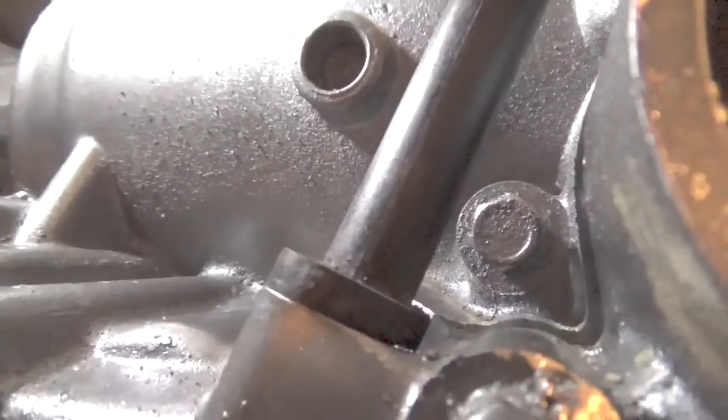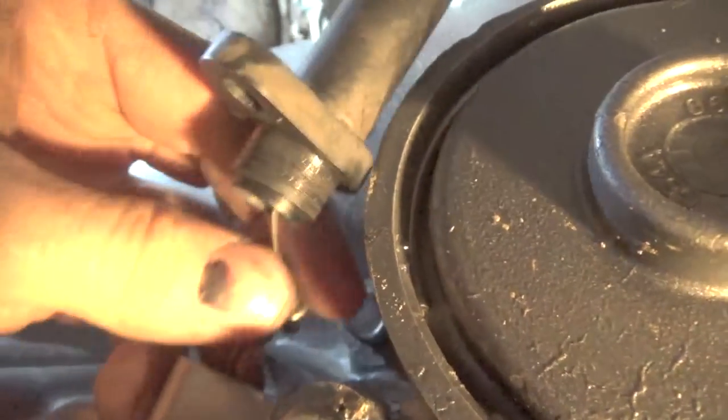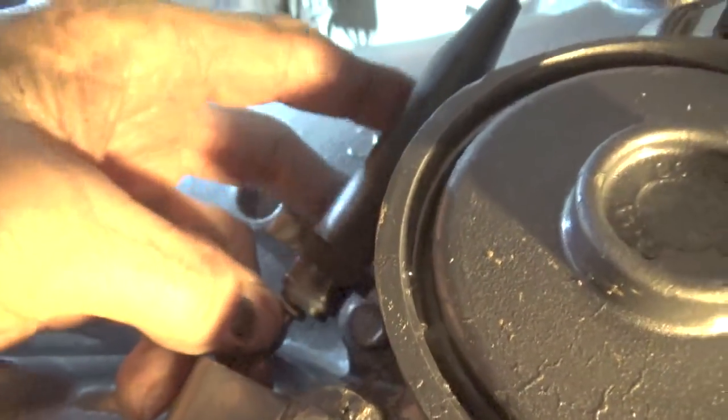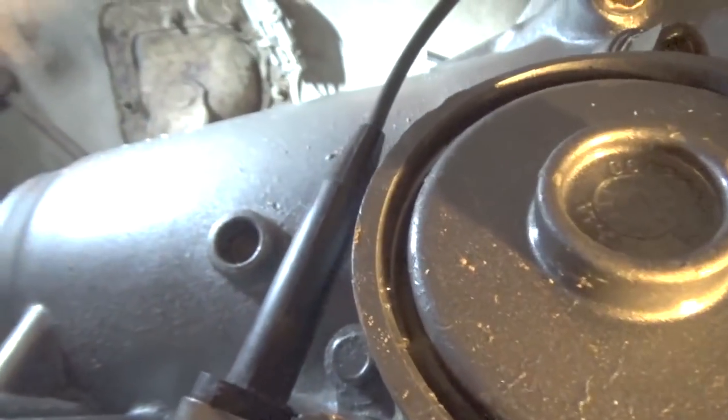And then what you want to do is, there's a grommet down in there for the rubber to seal this piece that goes in. So you want to just push that down in there and make sure that that linkage has stayed in there. Now you can't see the linkage once you push it down in, so you don't know if it stayed on there or not. But here's the thing, let me just pull this back out. Well, it came off, but if you look, you can see that this part of this cable comes down over top of this linkage like so, and it'll actually keep it on there for you. So when you push it, and then you push it down in, it's a little bit tricky, but once you do it a couple times, it's not a big deal.